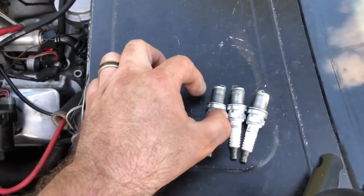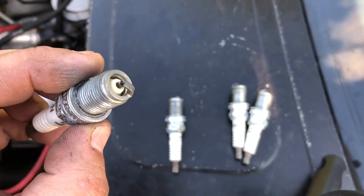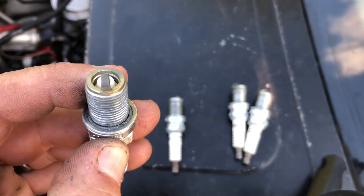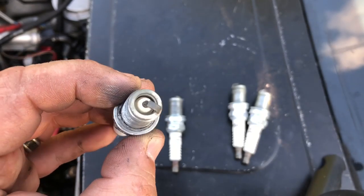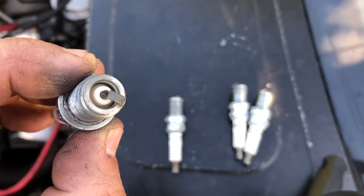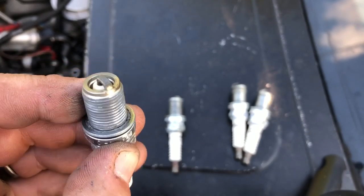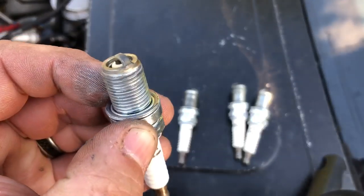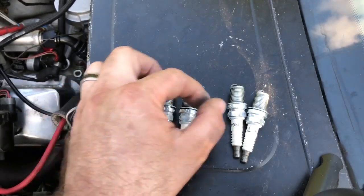Let's look and see what the other neighbors are doing. So this is number three. This one is pretty close to the same - there's hardly any cadmium burn on the base ring. So it looks like my fueling is good. My air fuel ratio is okay. The timing looks like it's just on the bend there, so I'm going to say the timing is good on both of those. Number one - we might could take out a half a degree of timing on that one.